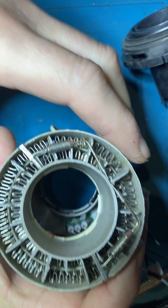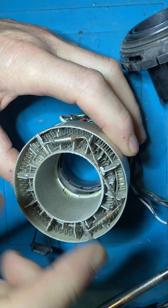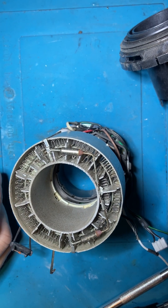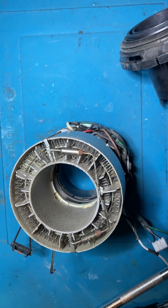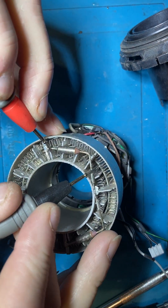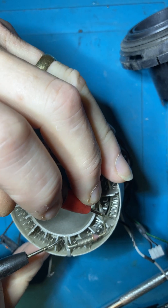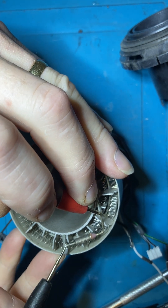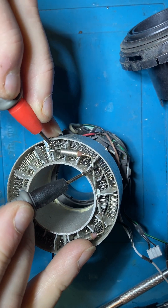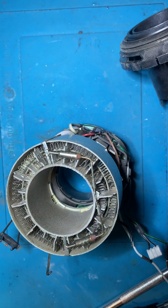Check that out - there's your thermal fuses, here and here. Normally one of them goes; it's very rare that both go. That one's not working. That one's alright. So that one's alright but this one's gone - that's the reason why it wasn't working. The thermal fuse.